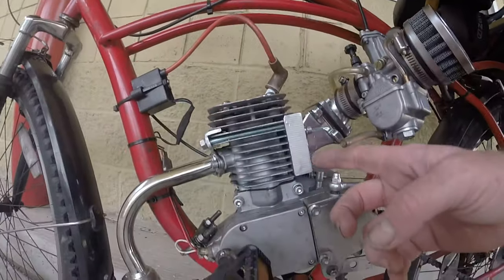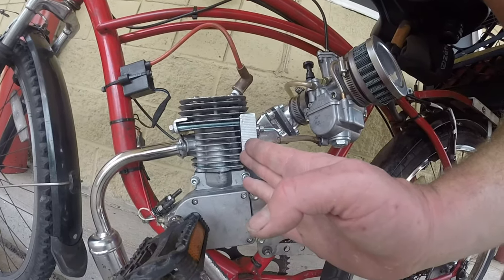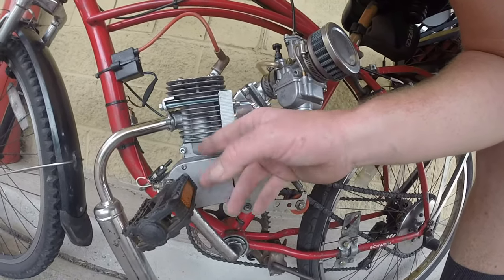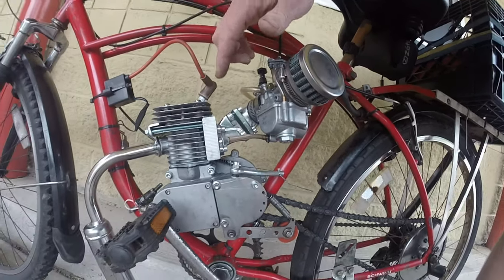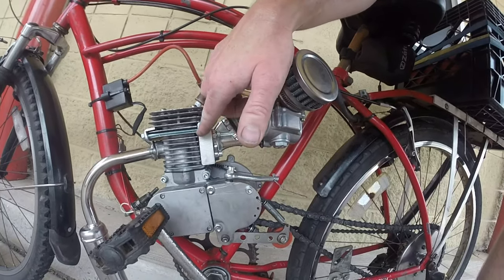No replacement for displacement - that old saying is pretty true. For the second cylinder, I took a regular stock cylinder and milled it down myself. I don't have a milling machine - I used a Dremel, cracked all the fins off to save time, then used the Dremel to remove the majority of the metal. The Dio-Reed uses a plate that has to mate up against the actual cylinder wall. The first one came out horribly - everything was jagged because this is a block of aluminum, rigid and square. I had a hard time getting it to mate up in the edges and corners. I didn't think of using a file until way late in the game, and I ended up screwing that cylinder up.